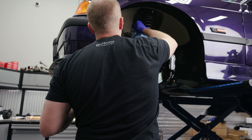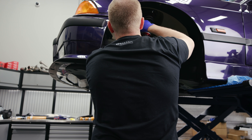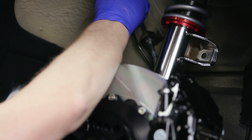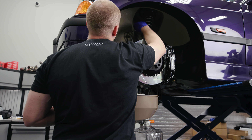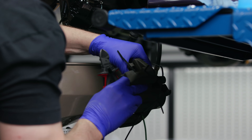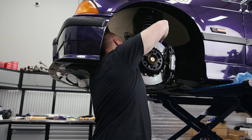I've got to get the right cap for this car — the Motive brake bleeder cap. I doubt the Tesla cap is going to work on this car, so we might just do a traditional brake bleed on this one. So I'm going to tighten this down and then go check all the bolts on this. I just got to figure out what to do with my wear sensor because this wear sensor doesn't work with my aftermarket pads.